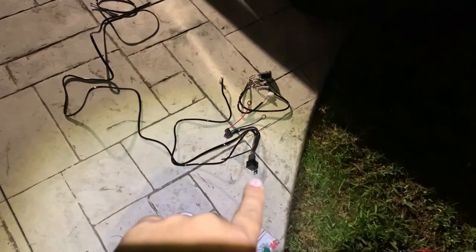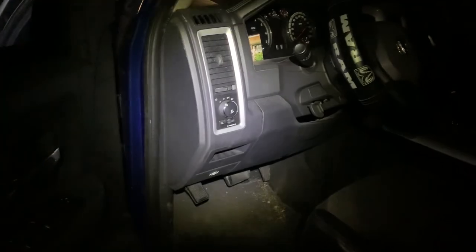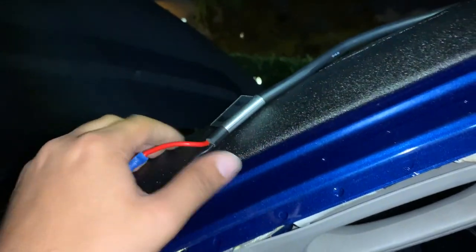The other wire will go onto the light bar. I'm running the cables through here — positive and negative — down and splitting: one will go into the engine bay for the fuse relay positive and negative, and then the switch I'll run through here into the cabin. The wires that run to the LED bar I'm running along the seam of the windshield.